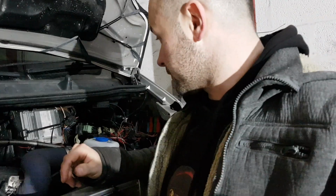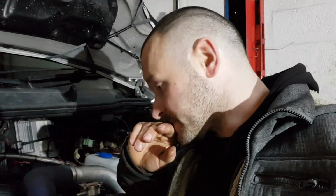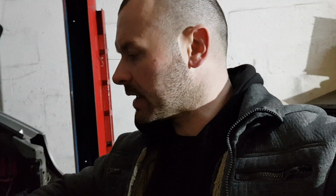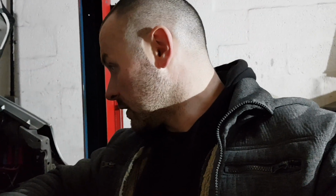Also, you have obviously the lift fuel pumps, one in the tank, one in the front of the chassis, which brings the fuel to the engine, and it has to run about, I think, 3.5 bar as a lift pump, or 4, or 4.5, I can't remember, too many figures in my head, it doesn't matter, but that has to bring that fuel pressure into the injection pump. If not, the engine most likely will go in limp mode.